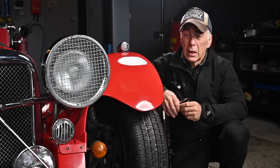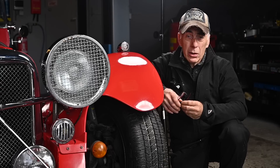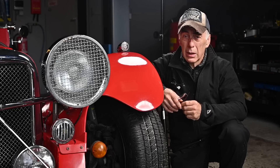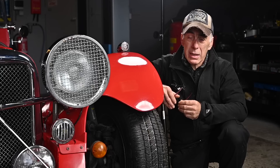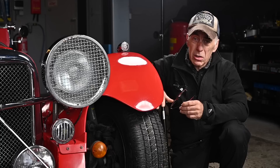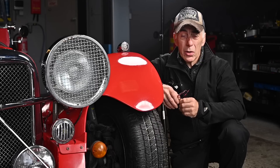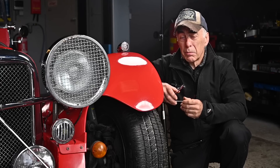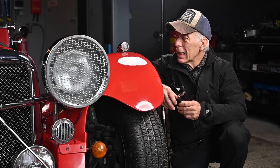We'll also check the oil pressure because I noticed the gauge didn't indicate proper oil pressure. Like with any car that's been sitting still for a long time, you should really change the oil before spinning it up for longer periods — that's something we'll do first. We'll also check the brakes: the brake pads, brake discs, and check for runouts. We'll check the chassis for rot, the suspension, and later possibly the transmission box — it's an automatic with a filter inside, but that's just standard maintenance, same as the spark plugs.